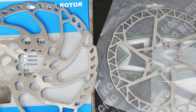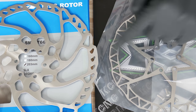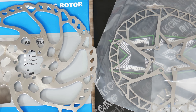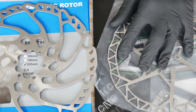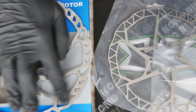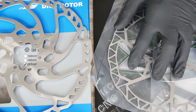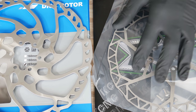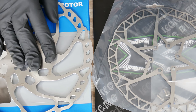The rotors. First we're going to have a choice between a lighter one and a heavier one. This one made by KCNC is extremely light — as you can see, there is so little material here compared to the basic one made by Shimano. So here we have less weight but less longevity, and it's easier to bend and easier to overheat. The heavier one has more weight but better braking performance and better temperature transfer. The lighter rotor would be the best choice for those for whom bike weight is one of the most important factors — like weight weenies, those racing in uphill races, or long flat MTB marathons. The heavier one will be more versatile, just heavier and more rigid.